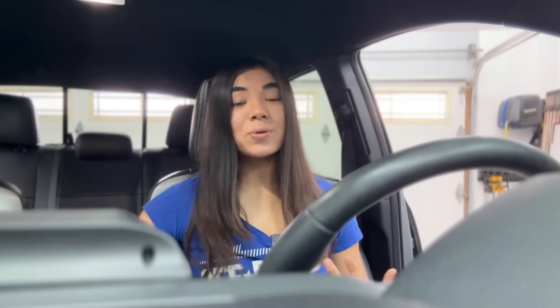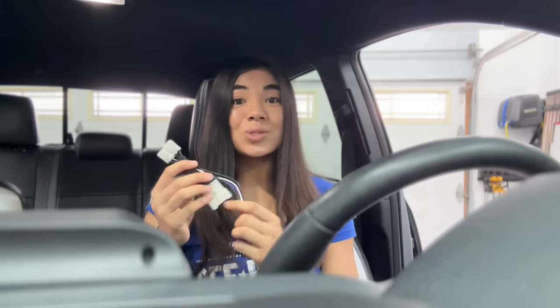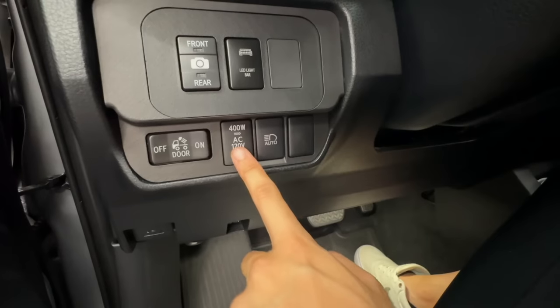Let's talk a little bit more about the 400 watts anytime. When you're driving, normally you can't get those 400 watts, which is a bummer for people who want to plug in their fridges and keep them cool while driving, or charge their Jackery — basically anything plugged into the bed outlet that needs more than 100 watts. With this modification, you can get 400 watts anytime. The harness tricks the inverter into thinking the truck is always in park, unlocking the 400 watts. If you're not interested in installing an outlet but do want 400 watts anytime, you can just install this wiring harness — it's 100% plug and play.